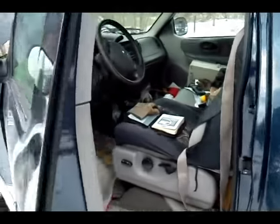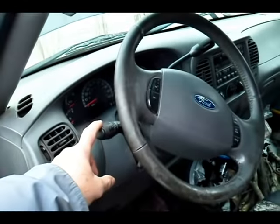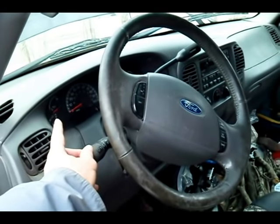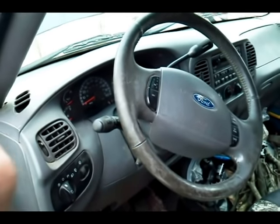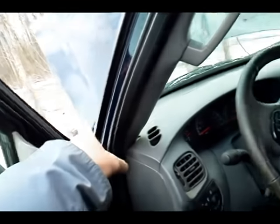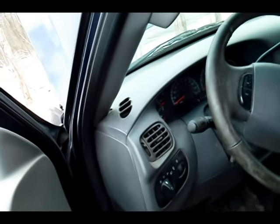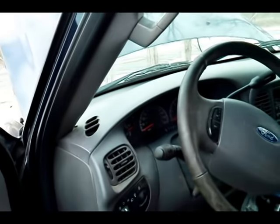The reason for this project was the turn signals. The left turn signal, when activated, would flash twice as fast as normal — that's an indication something is wrong with the electronics. The forward turn signal worked but flashed twice as fast as normal. The rear turn signal did not work, and neither did the rear flashers.